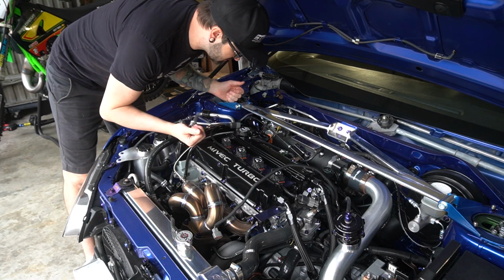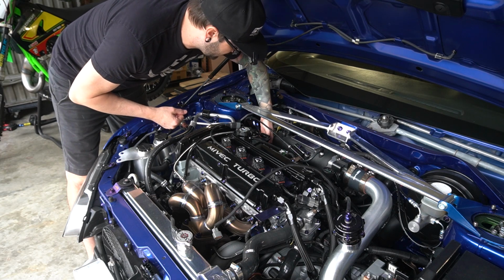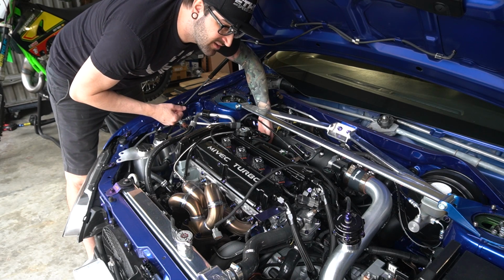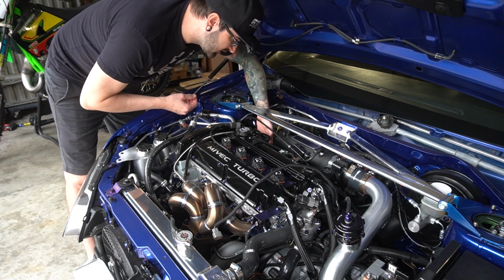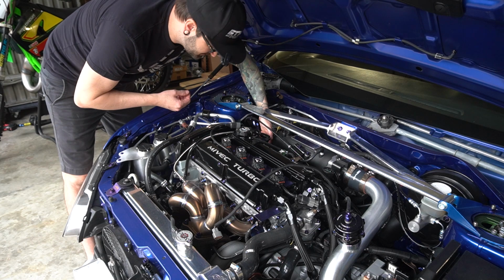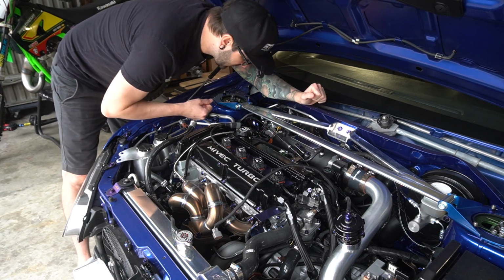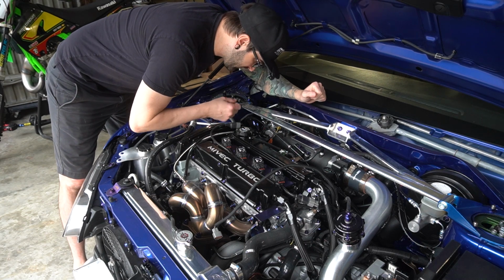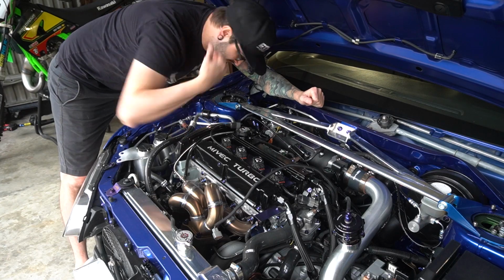Okay, it's a little bit difficult to show you, but the pressure regulator is right here. I'm just stuffing some towels down in there because it's a little wet right there. Sticky, maybe leaking a little bit. But anyway, we'll fix all that. So I'm going to take my wrenches and we'll pop off this fuel pressure regulator, put the new end on there, and then hopefully not get gas everywhere.